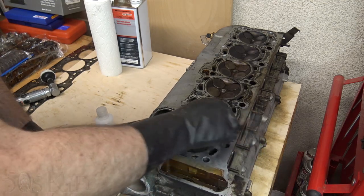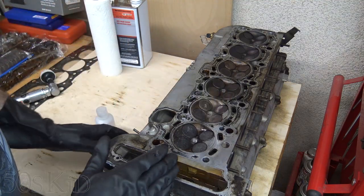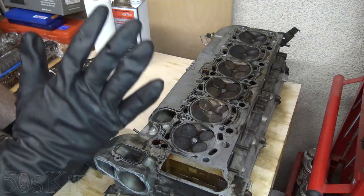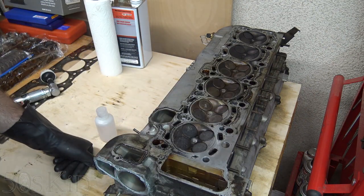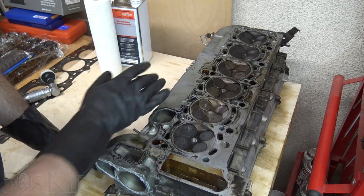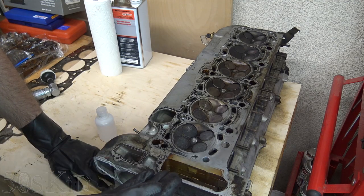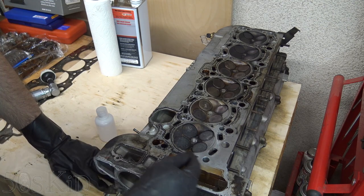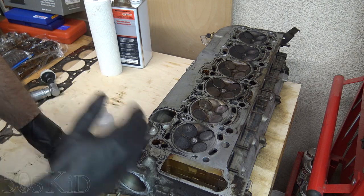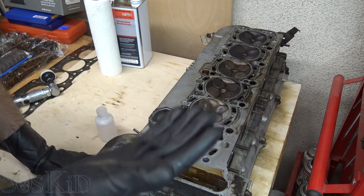I'm not going to film the whole thing because it's going to take forever, but you can see this is all you really need to get the whole thing clean. The reason we want it clean is because we need a perfectly flat surface to measure against and check clearances. As far as what this black stuff is around a multi-layer steel gasket — my theory is that it's probably microscopic blow-by gases with oil dissolved in them getting past the steel head gasket. Every other stroke or something like that, over time that stuff builds up, and the engine is really hot so it just bakes into the little crevices. That's my theory.